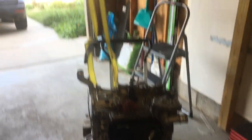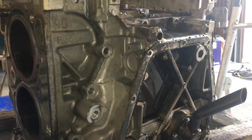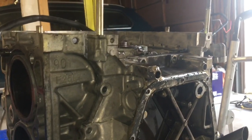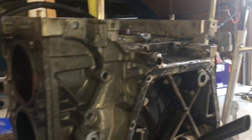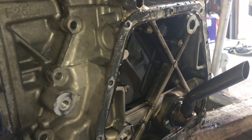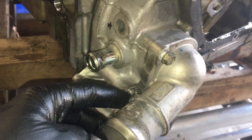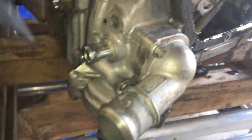I've got the short block flipped over — this is how I'm flipping it on the dolly. Of course if you have an engine stand it's a lot better, it's only 50 or 60 bucks. I'm taking this bottom plate off now, which I think is the last big piece coming off. Most of the bolts are obvious — all around the perimeter. The one that got me, where I bent the bolt, is right here behind the thermostat housing, so be careful for that one. The way I got the seal to break is tapping right here with a hammer, and then it just popped off.